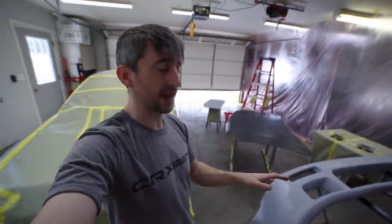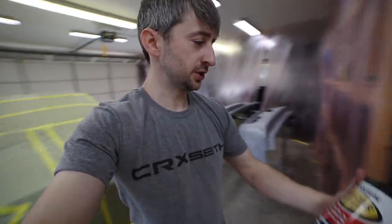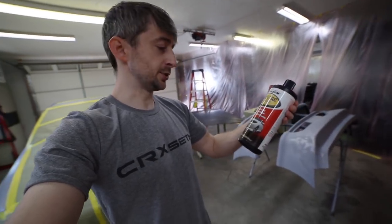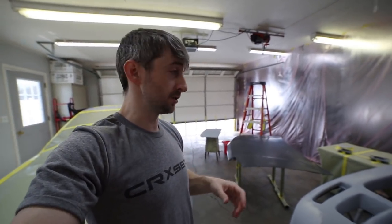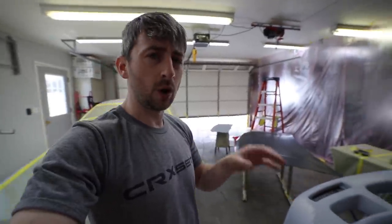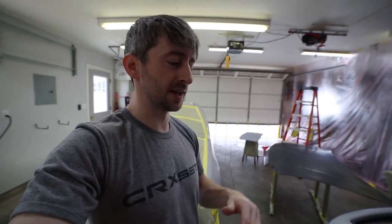Now with everything positioned where I want it, the last thing I need to do before paint is to actually just wipe it down with wax and grease remover. Actually, I didn't show you that, but it's just a Rust-Oleum wax and tar remover. I'll link it down in the description below. It's really good stuff. It'll wipe off any oils that are on the surface from handling it without gloves on. So that's definitely a must, because if you have finger oil or any kind of oil on there, the paint will not stick and it'll fisheye, and you don't want that because you'll have to sand it down and repaint it.